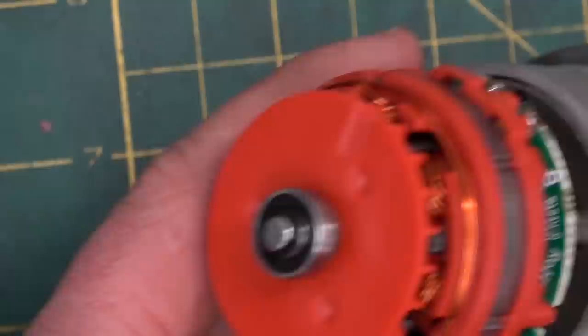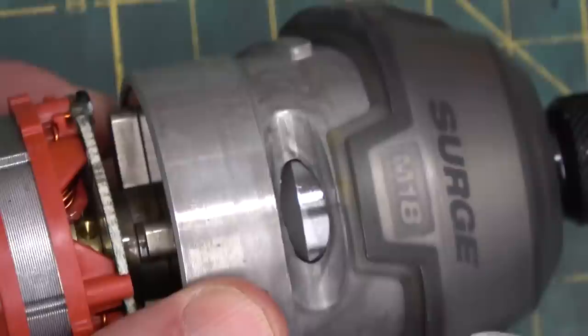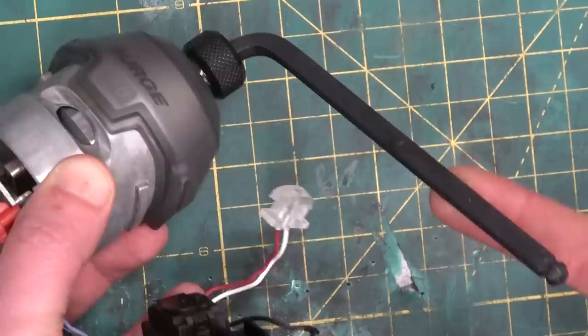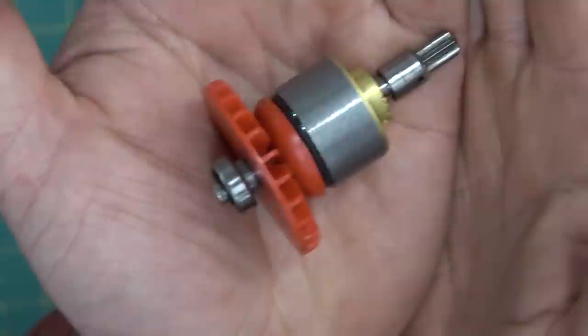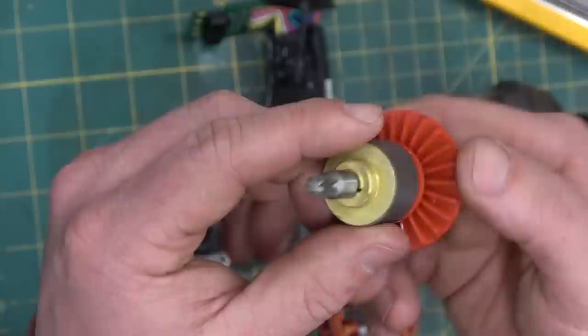On to the motor — we see on the rotor a tiny tiny little bearing, probably quite high speed, but it does come with a genuine circlip for retention. There is no mechanical connection — no physical or metal connection — dogs and cogs or a hammer and anvil — between the motor and the hitting end. There is a detent, however, so there is something going on in there other than straight hydraulic. Some sort of detent device. Here's the permanent magnet rotor — unbelievable power density — you see the size of it, it's just teeny tiny.